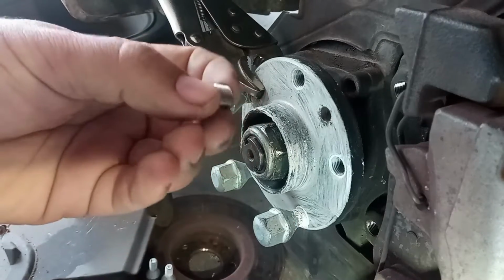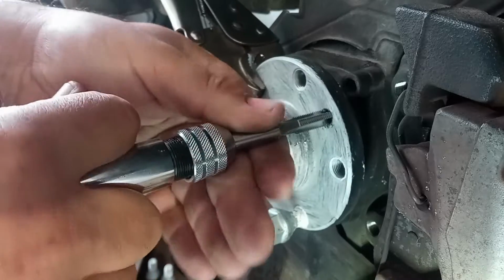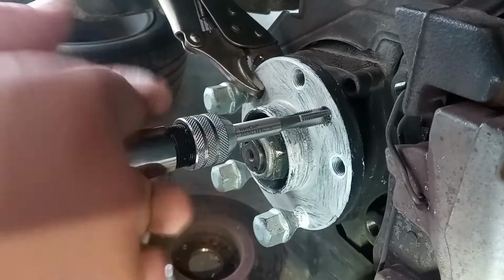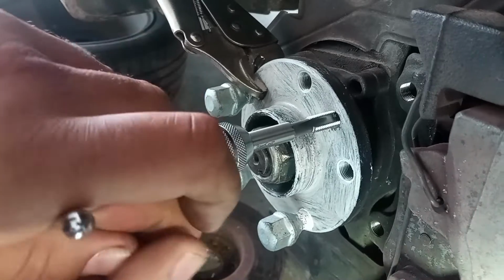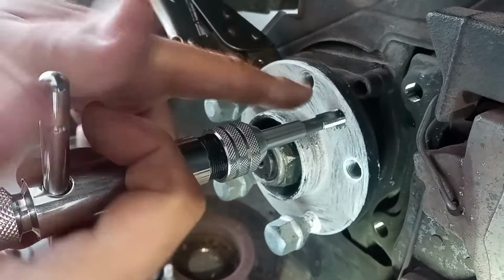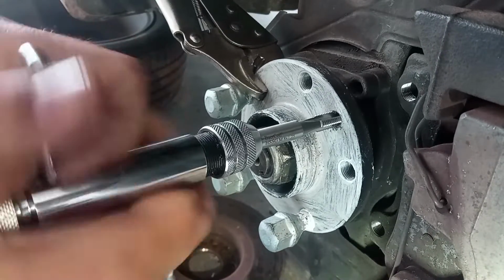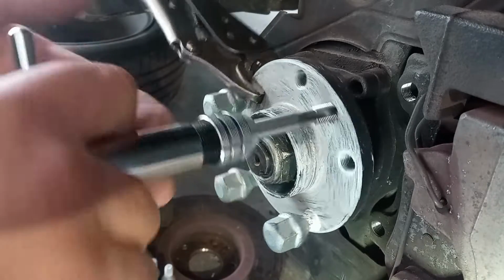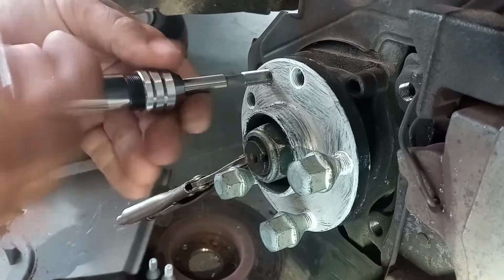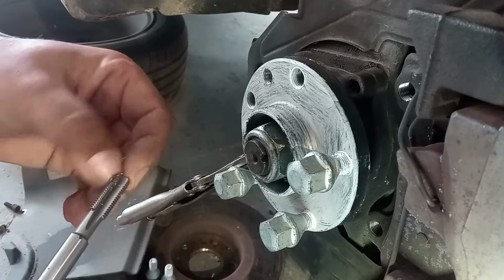Next, you want to make sure also that your helicoil is the same pitch. Okay, so everything is nice. The ceramic paste grease should be used at the end of everything, but some days have passed since this cleaning of the threadings, and I did not want the humidity of the rain to cause any issues over here, so I did apply the paste. Back it up a little bit to make sure everything is nice. Take out the excess. Start over.